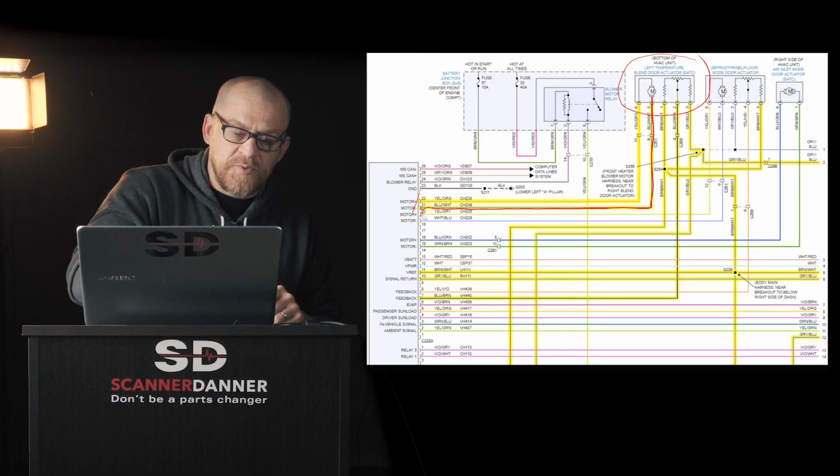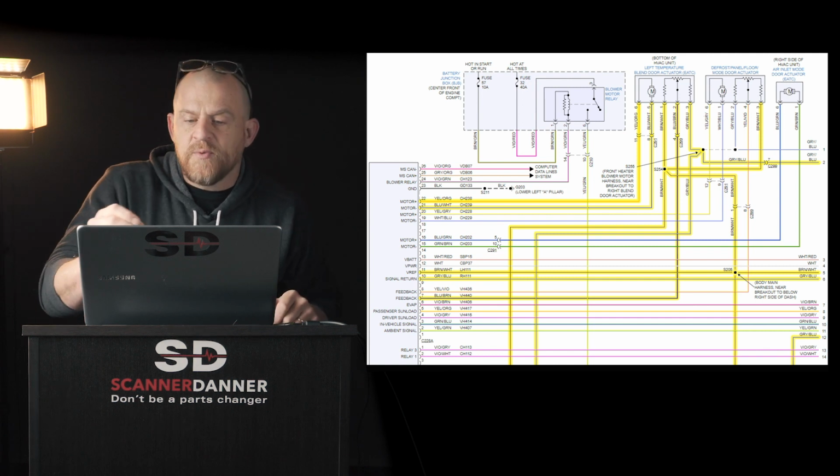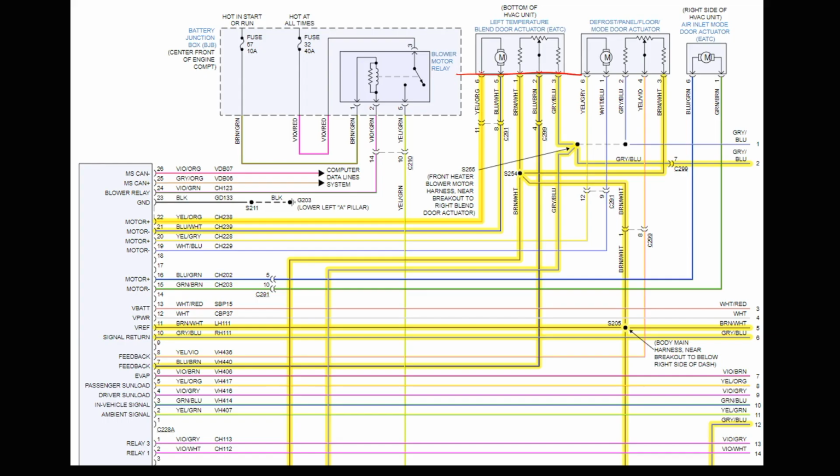When we used to test reversible DC electric motors in the field, it was a simple test. What you would do is disconnect it, and there are multiple ways this can be done. This is one that I would have done. I would take a test light and connect that test light to ground, and then command the motor to turn. And what I want to see is that light turn on constantly or flash, pulse. If the light lights, that's great. That means that the computer is able to apply power on that circuit.